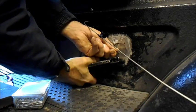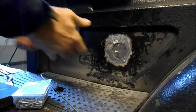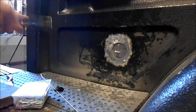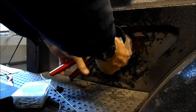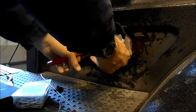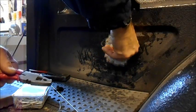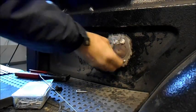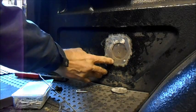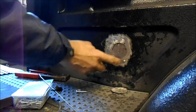All right folks, this is going to be our complete patch. The first thing I'm going to do is a little weld here and here to hopefully hold the steel in. Then we'll drill out the rivets and do the same thing there. Then we'll add the top circle and do an edge weld all the way around.